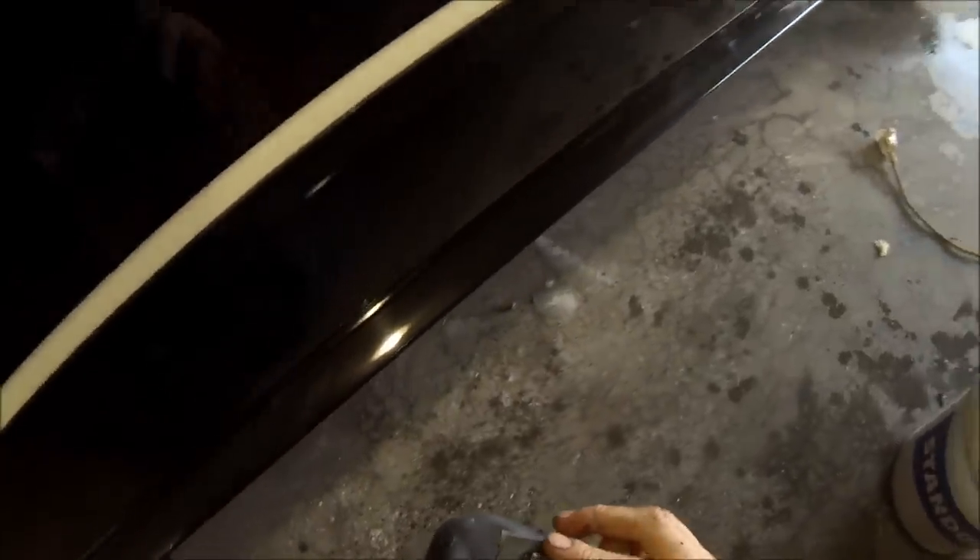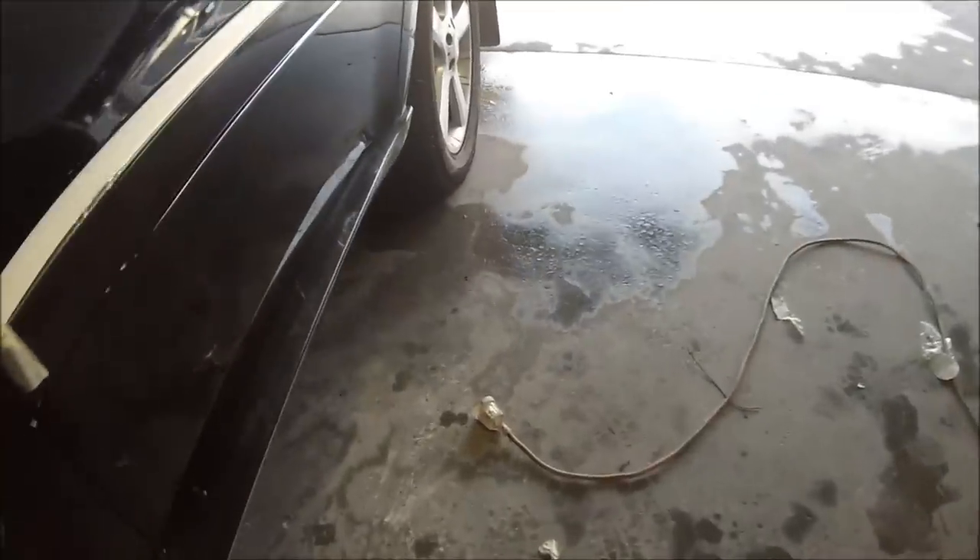If the paint was a little bit harder — if I'd left the car overnight — we could then use a big tungsten block which will shave the little piece of dust down, and we could also sand it dry with the Rupes Bigfoot small sander which you can get 76mm discs for. But for fresh paintwork I think you're just better off doing it the old fashioned way, just with a bit of water and a bucket.